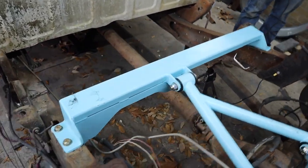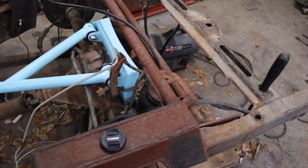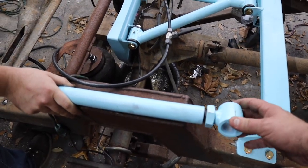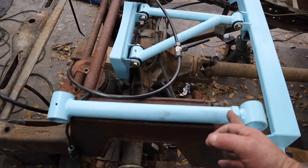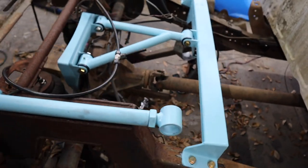There is our gas tank and front wishbone cross member installed, along with our wishbone and diff bracket. To complete the three-link, all we have to do now is install the lower link bars. These are adjustable — they screw out about an inch and three-quarters of movement. Personally, halfway is my max on how much of this should be pulled out. You've got to get your pinion angle decently right. If you're going from a stock truck, your stock pinion angle should work and you can just bolt this in place of your old stuff.